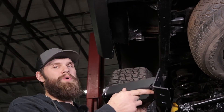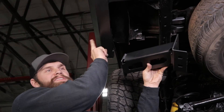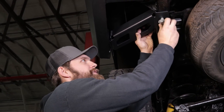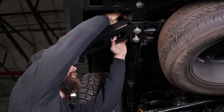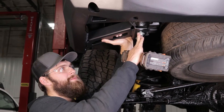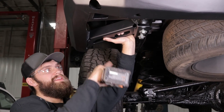Next, we can install our outer wing brace. These are going to mount with three bolts at the frame and they're going to angle forward where they will attach to the bumper with two bolts. Now you can tighten your bolts up at the frame and make sure this bracket is firmly seated against both the bottom and side face, and then you can adjust your wing position and tighten the outer bolts.